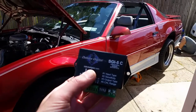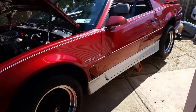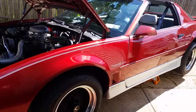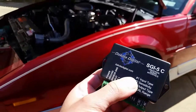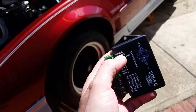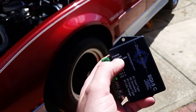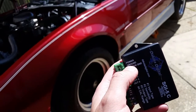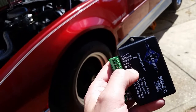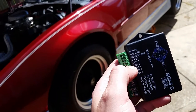We're putting this Dakota Digital box in. This particular model is SGI-5C, and we're gonna use the current VSS on the transmission and through this box make the speedometer work. We're gonna change the signal to work. You have a power or run hot — whatever is switched ignition hot, that's the power you're gonna use. Then we have a ground from the box straight to the body of the car. Sensor ground — there's a black wire that goes straight here, and the other wire, which is yellow, goes to the input. Then you have one output that goes straight to the speedometer.